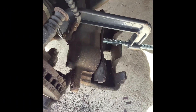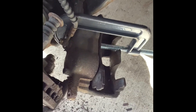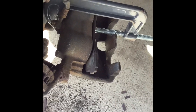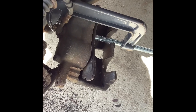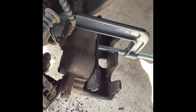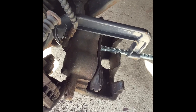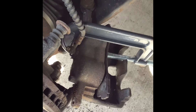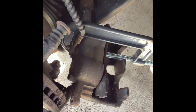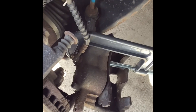I tried to use the smaller C-clamp but I had to run into town to get my bigger C-clamp out of the shed. Then it only took about a minute to push both pistons back in. I've got the old brake pad bridged across the two pistons and just turned the clamp in — now I've got plenty of room to put the new brake rotor on and the new brake pads, so we're going to do that next.